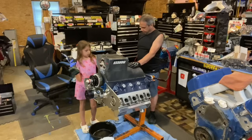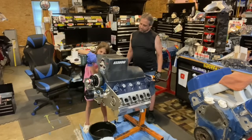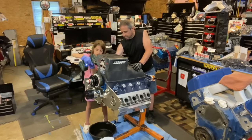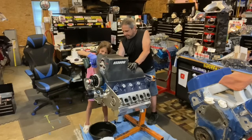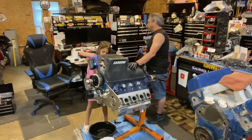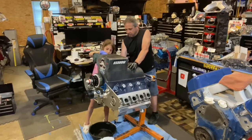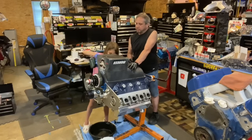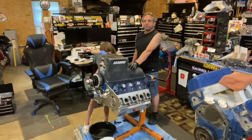What about these ones? Those are the head bolts. We're not taking those off right now. Maybe later. But that brings me to the point I was trying to get to: when you get this far, how far do you go? If the pickup just fell, do you just put that back in there, pull the bearings, and look at it? Yep, it's good to go. With all the metal, they take it right down, clean it up, and re-ring it.